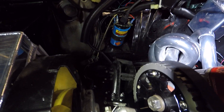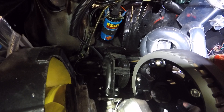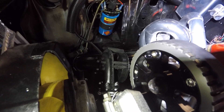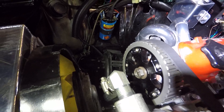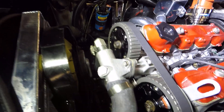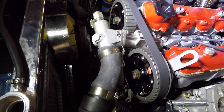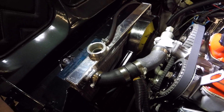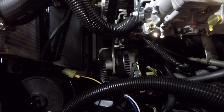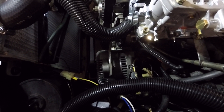This car also features our electric water pump system, which really eliminates a lot of drag from the engine trying to spin that water pump. It eliminates the need for the mechanical water pump and a thermostat. It's got an adjustable controller, so you set the engine temperature where you'd like it to run constantly. The car also features our billet aluminum radiator and our 95 amp alternator, so we've got plenty of power to run the ignition system and a stereo and amp if need be.